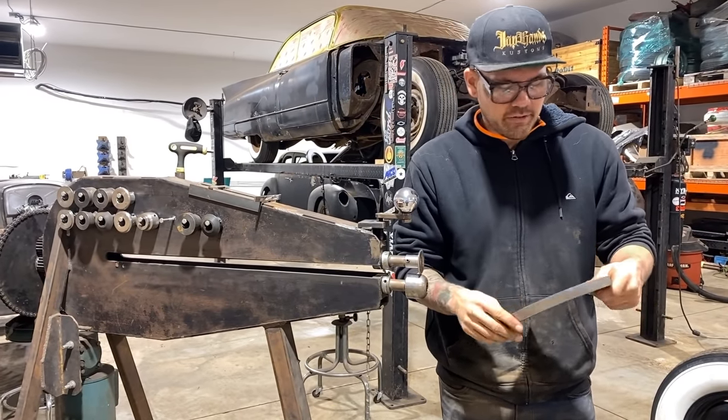These edges — the hammer formed edge here — we could have taken a hammer and dolly and just tapped out the little imperfections, but I'm just showing you the difference between both methods. Hopefully this has been helpful for curved flanges. When I first discovered being able to make a curved flange without welding one, it definitely helped me with a lot of different panels. It expanded my way of thinking about how to approach making a panel.